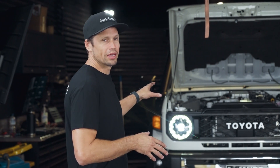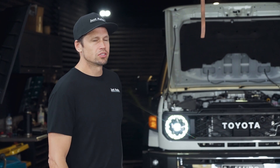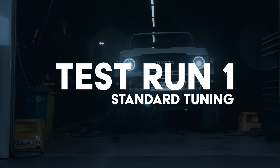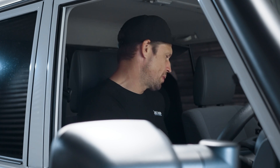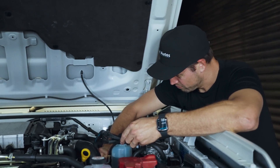Obviously we don't have a canopy on the back, we don't have dual batteries, water tanks, or bigger fuel tanks — none of that gear in the car. So the car is only simulated here on the dyno, giving it load as it will towing a heavy load — not so much the weight of the vehicle. What we're logging is engine speed, our intake temperature which is basically what the MAF reads from the air coming into the engine, our coolant temp, and the ones we really want to see are our charge temp before and after the cooler.